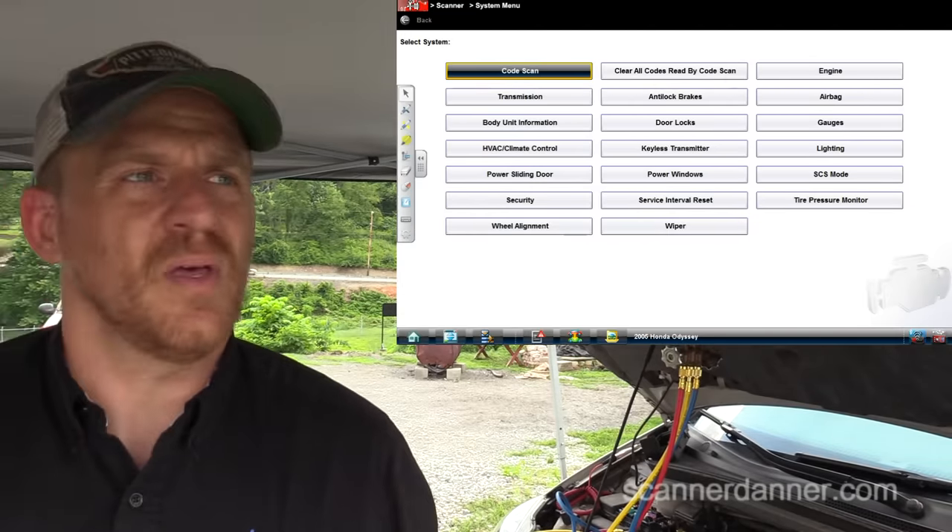Switch is on up top — this should be lit on both sides. Good and good. What that tells me — and this is an important test — is that my load side feed coming into this circuit is good during a loaded circuit situation. No amperage means I have an open. That open is not on my feed side. Feed side is good.